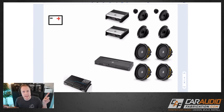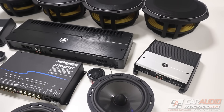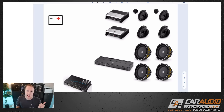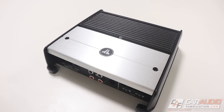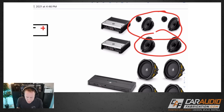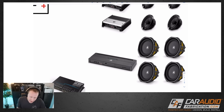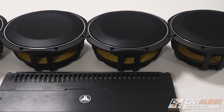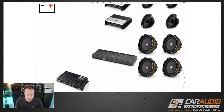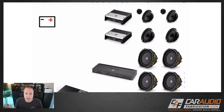In this video we're in the design stage, planning out our electrical system. The first thing we want to do is lay out all the gear. I'm using an iPad so it's really visual. We've got two different two-channel amplifiers — each powering a set of speakers. Up front we have component speakers, in the back we have coaxial style speakers. We also have a 1500-watt amplifier powering four 10-inch subwoofers, and a digital signal processor to control time alignment, crossovers, and equalization for each channel.